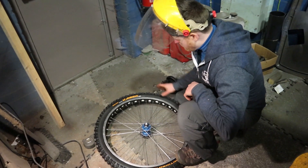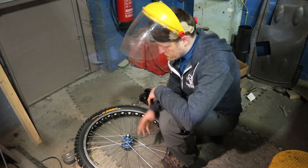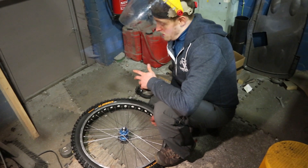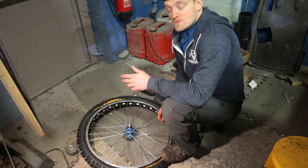One-handed grinding with the tyre on. The advantage of doing this is that you don't get all the release agent and gunk from the tyre and tube on the rim sidewall, which reduces your braking performance. You can even do this mid-competition - put the bike upside down and just whiz around with the grinder. People sometimes take battery-powered angle grinders to competitions.